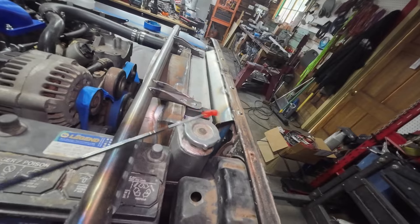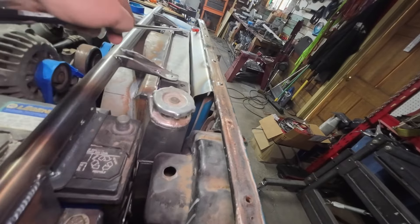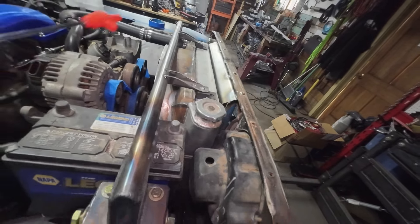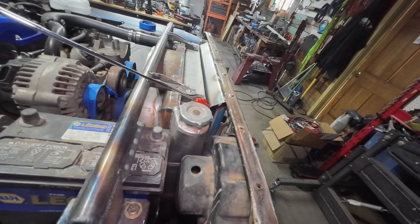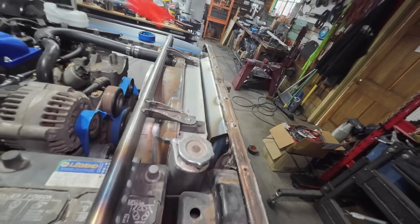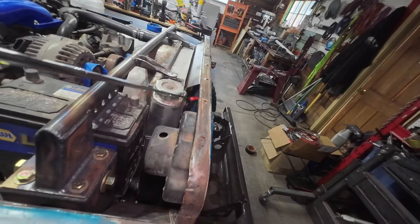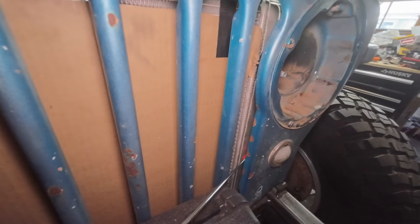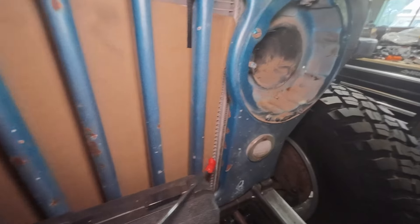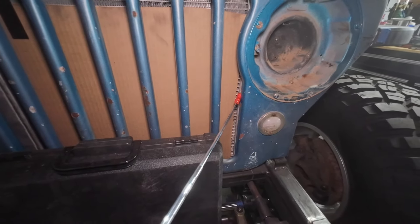Here's what that ended up looking like — it's just a panel that fits in and screws in on top of the grille. These screws will probably also hold the welting on eventually. That just keeps the air from bypassing the radiator or recirculating in front of it, and gives enough space for movement between these two panels. I'll probably stick a piece of rubber weather stripping on the flange during final assembly. The next ones will be doing something for the hole around the headlight — not super sure what's going to look great in there. And I need to do something right here around the radiator. I think that one can just be a flat piece that spot welds to this flange, about an extra inch tall, and that will keep the majority of the air there. The bottom is tight to this cross member, so I don't have to worry about anything on the bottom.